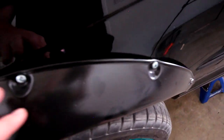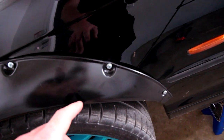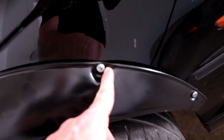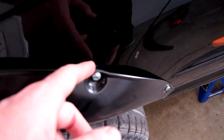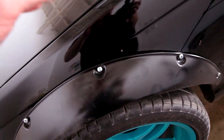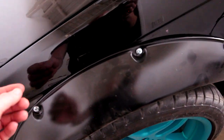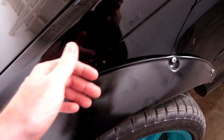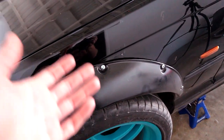The gap comes from the fastener spacing being slightly off — certain rib nuts need to be repositioned slightly, which I may fix in the future. If you care about proper fitment, you can mold the flares better in two ways: first, buy a rubber fender flare trim piece that sits on the back of the flare and helps it adhere to the body line; second, use a heat gun on the flare to help it mold and form to the contour of the stock fender. But this is a drift car, so I think I've done my due diligence.